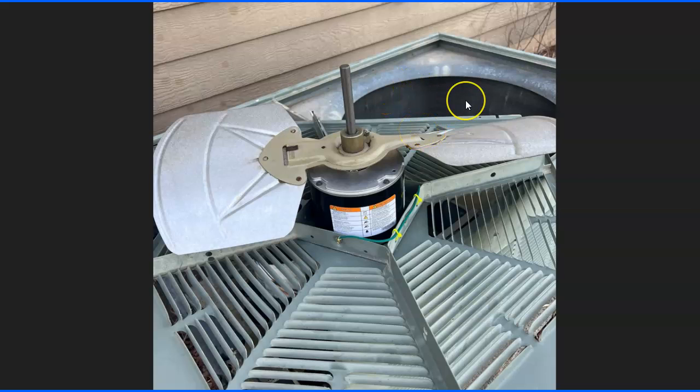So I looked at what was coming out of my vents, and I was getting 60 to 66 degree temperature out of my vents when the fan was right here, because I put it halfway just like the other one. And then after I read, and somebody mentioned to make sure your fins are at the right depth, I did some research and I needed to move it up.